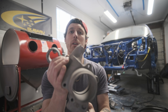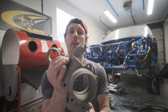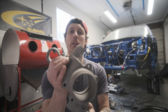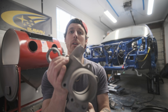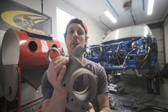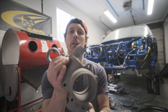I was messing around with the little bracketry for this piece — it's got these little teeth that stick up and there's nowhere for them to really press in. They sit in between the slit and the center, leaving a huge gap, which doesn't seem ideal. So I took one of them, set it on the concrete, and smacked it with a sledgehammer until it went flat. I think this will really help keep everything solid. Because I did that, I scratched it down to bare metal in spots, so I'm going to scuff it up and touch it up with that SEM paint.